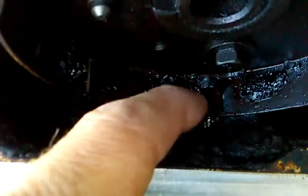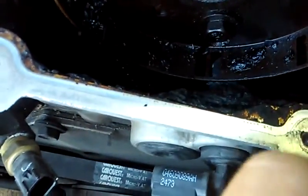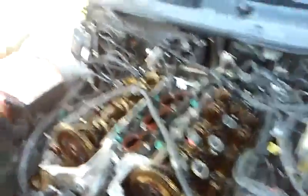Down in here where my finger is, there's the sensor right there — you can see it's right underneath that slot. There is a magnet inside of there, and as this turns in timing with everything else, it creates a magnetic field between that magnet and this pulley. That magnetic field sends a timed magnetic pulse to the computer of this car every time it makes contact.